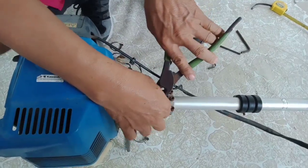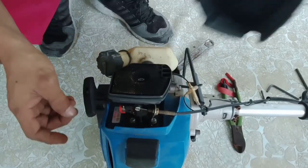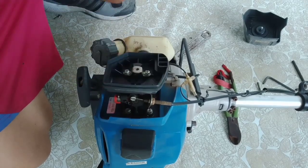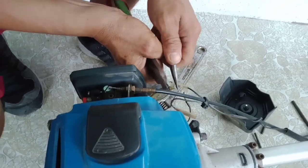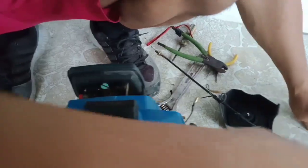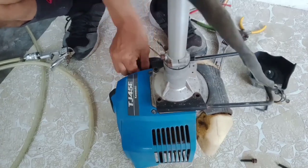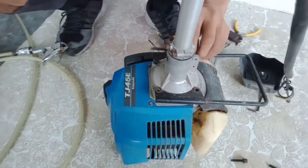I removed that because that one is wrong — it was attached to the body of the grass cutter. If there is damage there, it will get grounded, and that is one reason why the grass cutter or brush cutter won't run. This machine has a lot of names all over the world, like brush cutter, string trimmer, weed eater, weed whacker, weed walker, and many other names.